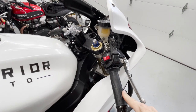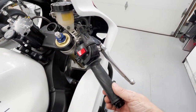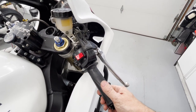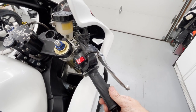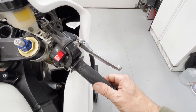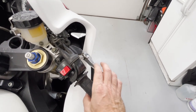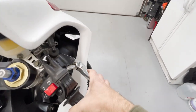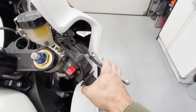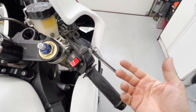Back to the front — this is also from Spears, and it's a modified R6 throttle. The difference is the degree of rotation to go from closed throttle to wide open throttle. On the stock SV it's a quarter turn; on the R6 it's a one-fifth turn. This was one of the most necessary things I've done. I was constantly having to re-grip the throttle to reach wide open or to close it. There were times I'd go to grab the brake and not have the throttle fully closed — the rear wants to pass the front, and that's not a situation you want. This completely solved that. I don't have to re-grip at all. Highly recommend this modification — it's about $15 and totally worth it.